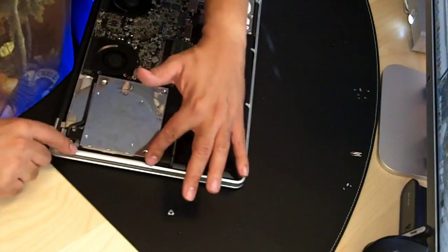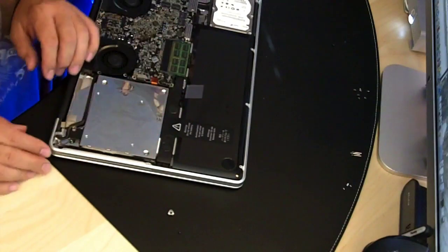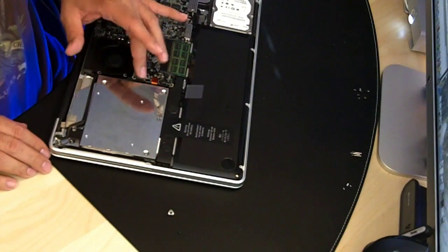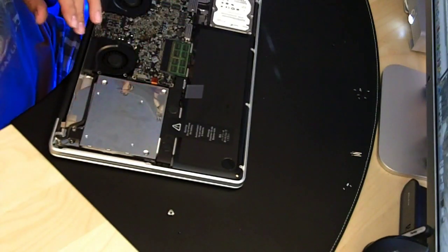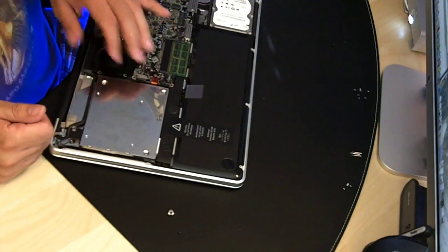That's it. Remember, you're not putting these two front screws back in. Basically the case is going to be holding this in place. Be very careful with this connector because that's what's sending all your video out to the display.